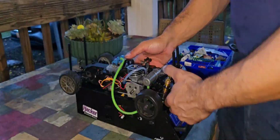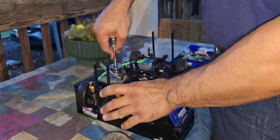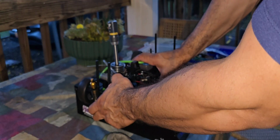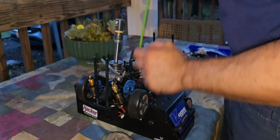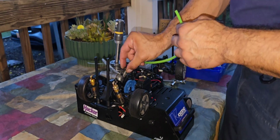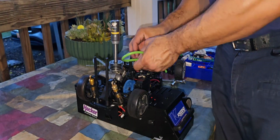And here I am showing you guys, there's no pinch. I'm turning the wheels, no issues. I'm talking about, well, you know what? The sleeve, the engine is worn out. I don't have a one way on it. I don't have a pull start. That's not going to help out either. But I'm still thinking maybe if I lean it out enough, she'll at least run.